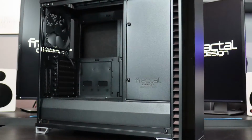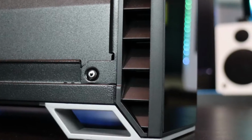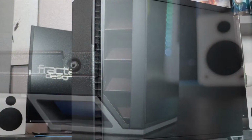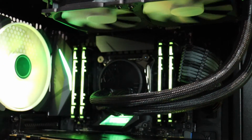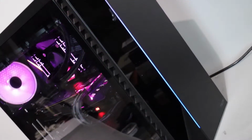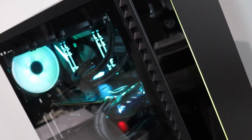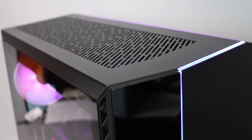Let's make it simple. The cooling is quite alright. It has nice airflow because it has openings on both sides. You can change the top from tempered glass to a ventilated part which even has a dust filter. If you want tempered glass, I wouldn't suggest placing anything on top. I would just make an airflow going from the front to the back, and that's basically all there is to it. Temperatures are quite alright, I would say, for air cooling and even for liquid cooling. If you place a Noctua or something like that, a CPU tower air cooler.